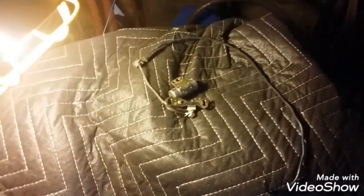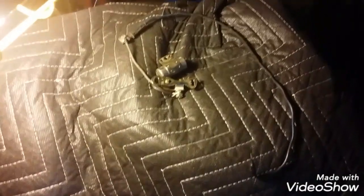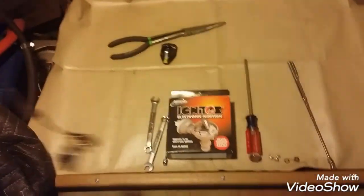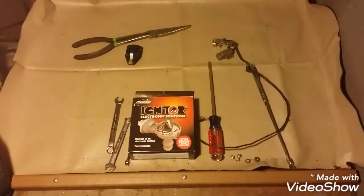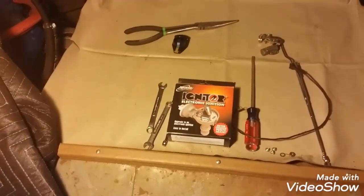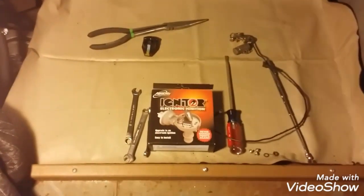I'm going to put it back in that box and leave it in this vehicle. This vehicle might road trip one day, and if something catastrophic ever happened, I could always put that back. So I'll leave the screws in the box, I'll leave the points and condenser in the box. It ran once — I could, on the side of the road, install those and make it run on points again. You don't have to undo anything that's critical.